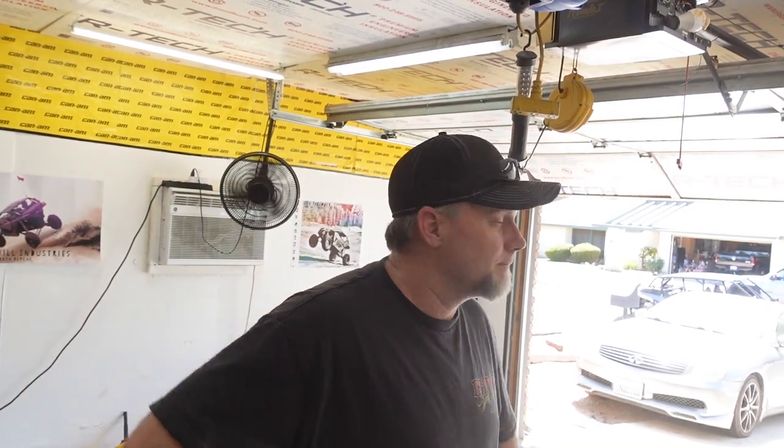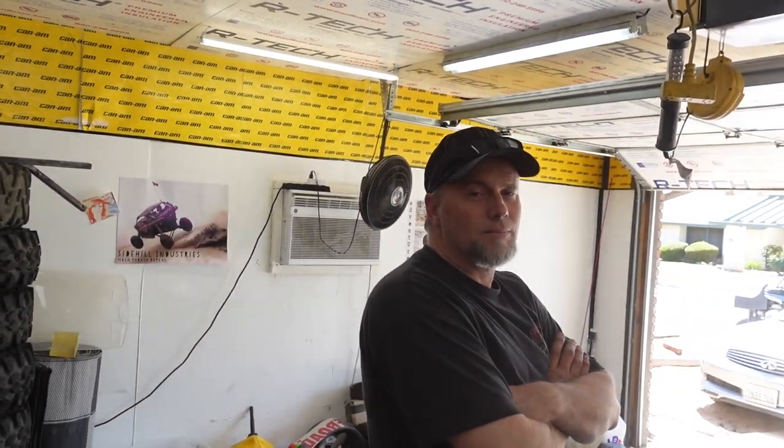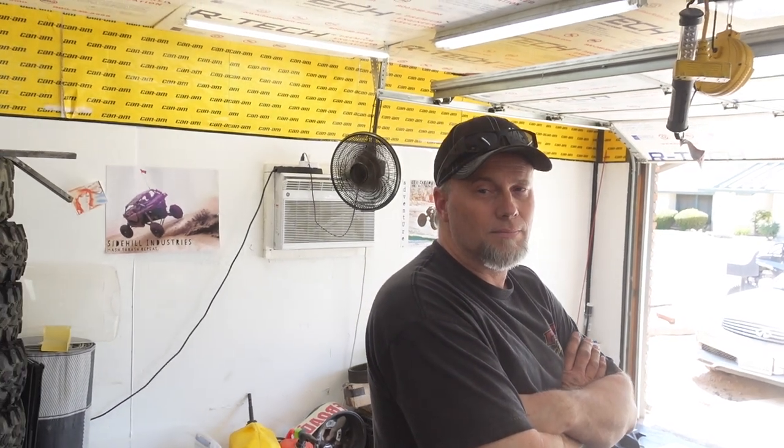Good. I got 19 pounds of boost just right here, in like a 200 foot little run. Yeah, just a blip out in front of the house too. Just a little blip of the throttle, really. 19 pounds. So I think there's a good chance we'll see that 22 we're looking for with this tune. We got to figure out what tune we're going to run when we do the 0 to 60. It's still on the E85 tune, which, you know, I think with the oil change is probably okay.